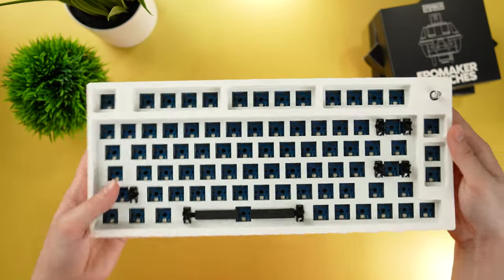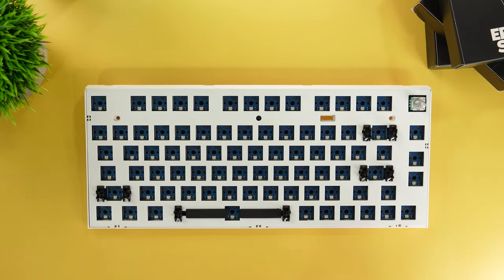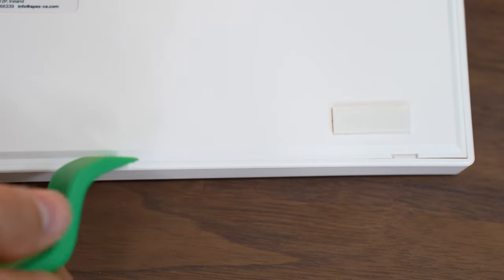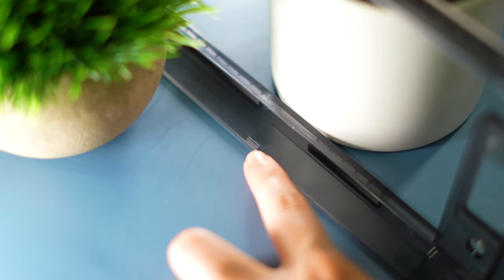Okay, so like I said, the TH80, to get open the case, you have to flip up the flip-up risers and then there's a screw in each side and then you pop the case apart. Now you might say, well, snap-in cases typically have problems. That's true, but this one is not a flush case on the back. You can actually see the tabs when you flip it over, which is a very good thing because if you get something in there, a little piece of plastic, a pry bar, really you could use whatever, a flathead screwdriver, you can pop them off very easily. This mitigates the chance of snapping those off.